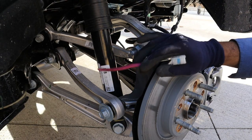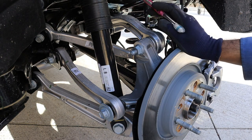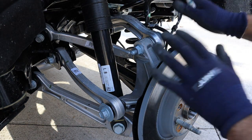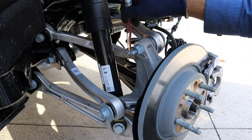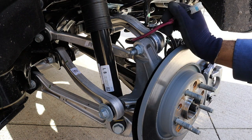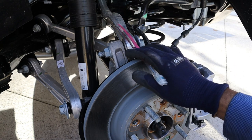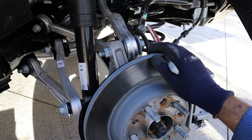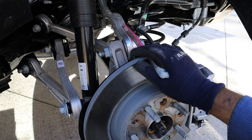Taking a look at the rear suspension, I think they went full German or Italian on this design at the back. There are five links controlling this rear knuckle — two of them use a spherical bushing at the knuckle whereas all the others use regular bushings. All four upper links are made of aluminum to save weight. This five-link design is great for off-road articulation, but in the long term it's going to be more expensive to repair compared to something like a minivan because there are more links that will fail, especially if you go off-road and the bushings wear out.